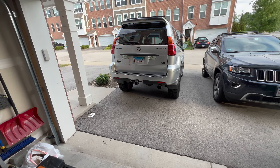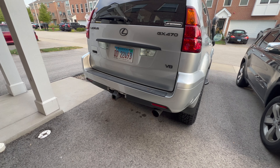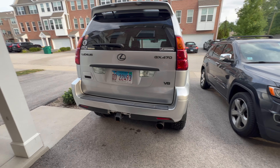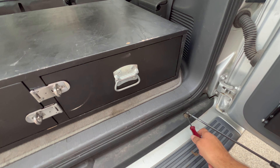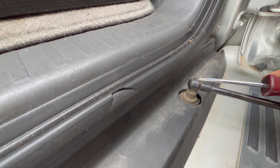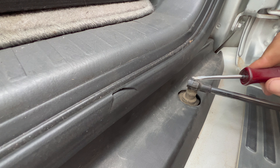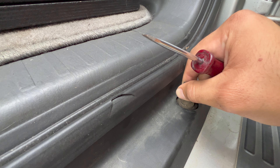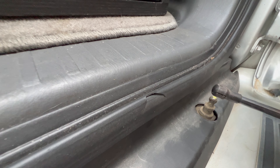It still gives you a lot of clearance in the rear. So what we're going to do is start by removing the bumper cover, the Metal Tech hitch, and then we'll go from there. First step to removing the rear bumper cover is to take this off. I've done the strut mod and I basically have this metal clip that's just going to push off like this. If you have the normal OE strut it's going to be a nut or bolt — I can't remember exactly what size — but once this is off, this just comes off like this.